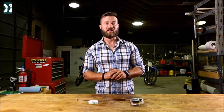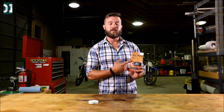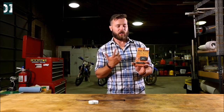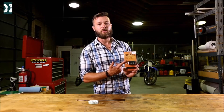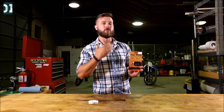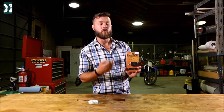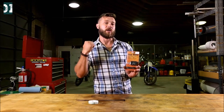Skip that next trip to your favorite coffee shop, keep five dollars, get on eBay and buy one of these. This is an hour meter for your dirt bike. It tracks hours of your engine, so it's very easy to stay on top of your maintenance. You know how many hours you have on your engine, you can do your oil change every six hours, then you can do your valves, your top end, and you know exactly how many hours you have on your engine.